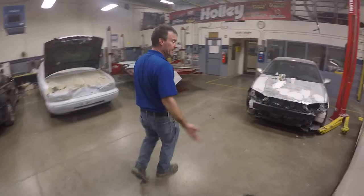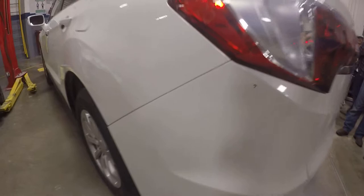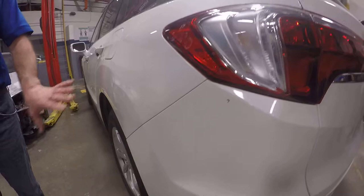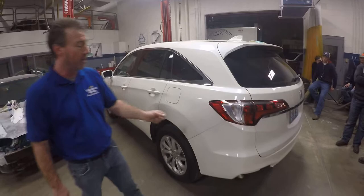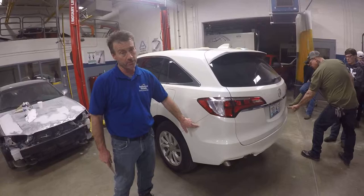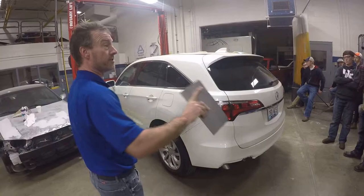This is a brand new vehicle — take a look right here. Can you see the differences in color? This vehicle has never been worked on or painted, but we're already dealing with a mismatch between the plastic part and the metal. We've discussed in class what causes that — a lot of times it has to do with static or the substrate we're spraying over, such as rubber.